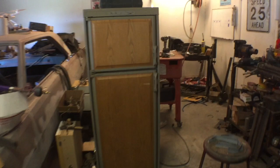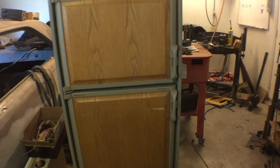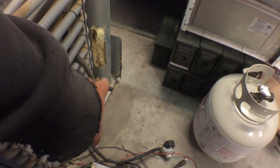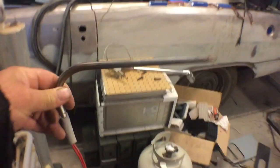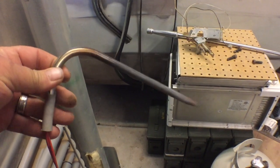Let me show you what I picked up last weekend — a refrigerator. I probably paid too much for it and broke a bunch of my own rules, but it does work. It was just missing some key components — like the regulator. I found a complete regulator and burner on eBay for 40 bucks. In there is the AC heater element: when you plug the fridge in and select AC for shore power, this heating element heats up the ammonia. This one doesn't work — I had it plugged directly into 110 and it didn't heat up, so I need a new one — about 40 bucks. I bought the fridge for 200 bucks, so I'll have less than 300 bucks into it. You can buy those new for a thousand.